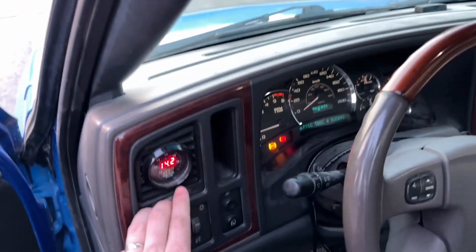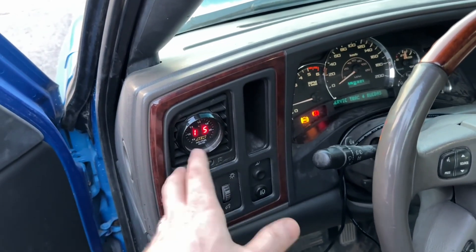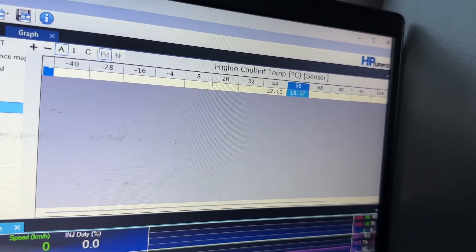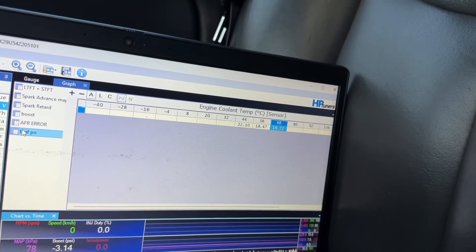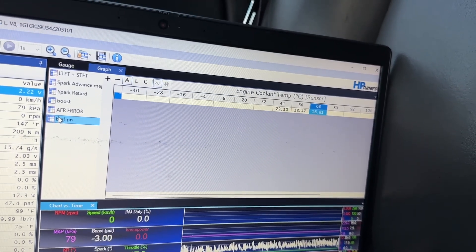Right now it's actually not too bad. I did play with the VE a little bit, so it's getting a lot closer. Idling between 14.0 and 14.5 — not bad. I'd like to be up around 15-ish with the cam, and it may get up there as it warms up. Right now you can see it started around 22 and it's down around 18. So that's going to get an average. As the engine warms up, it's going to jump to that next cell. I'm going to have to do this two or three times because that 18.47 was still dropping — the engine warmed up faster than it could collect perfect data.